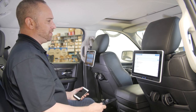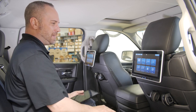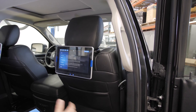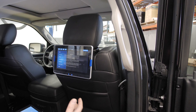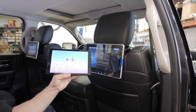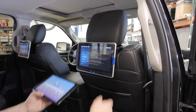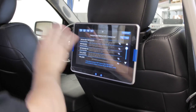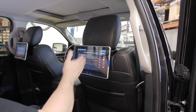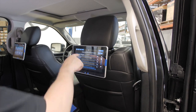In this case, I don't have Wi-Fi in this vehicle so I'm connecting to a personal hotspot. I connect to the hotspot, it shows me I'm connected, and then I go back. Once connected to Wi-Fi, in the setup menu, VoxLink is a unique feature available only for Vox electronics products — in particular the CPAC system. It allows you to have a virtual remote control. To test that functionality, the first thing you want to do is download the VoxLink app, which is available on the Google Play Store and the Apple App Store as a free app. Once you've downloaded it, go into the system menu and make sure the monitors and the unit are all connected to the same network. Connect the monitors and your testing device to the same Wi-Fi, and you're going to see that confirmed on the screen.